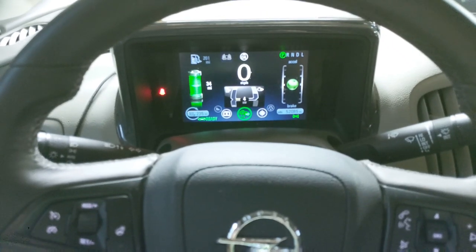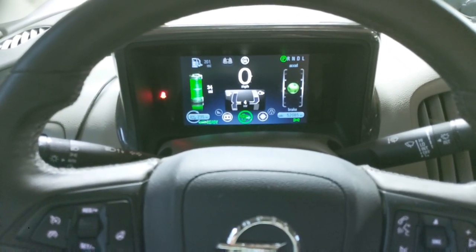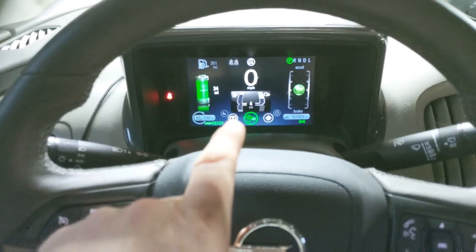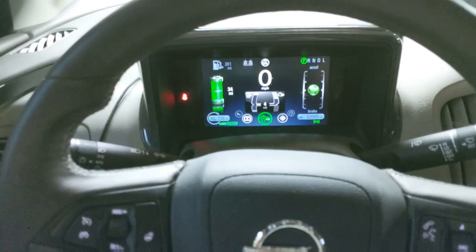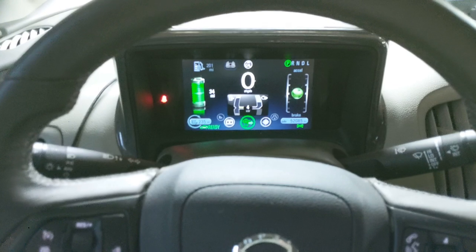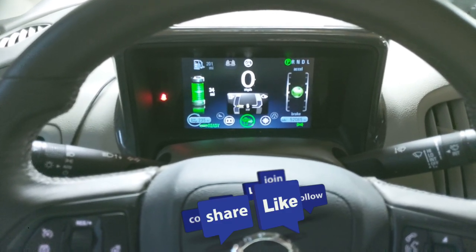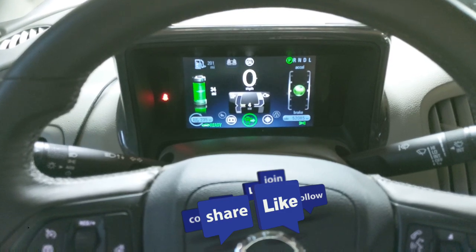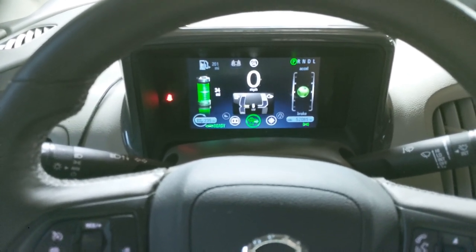The only thing to do now is make sure you top off your coolant back to the original level, get in the car, turn it on, and see if you have heat. You can see on the dash we're pulling four kilowatts right now — it was actually up to seven when I first started the car — and I do have heat coming out of the vents, so our problem is fixed. If you like these types of videos, please take a look at my other videos. I normally do a lot of build-it-yourself type stuff, but I occasionally fix things when they're mine and broken. Please like and subscribe.